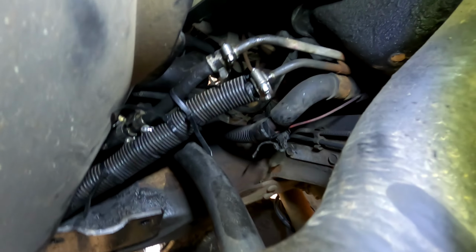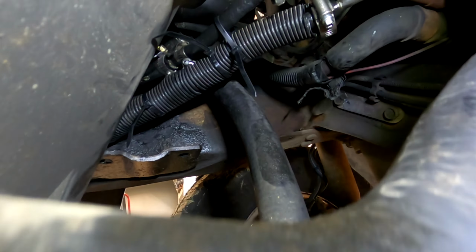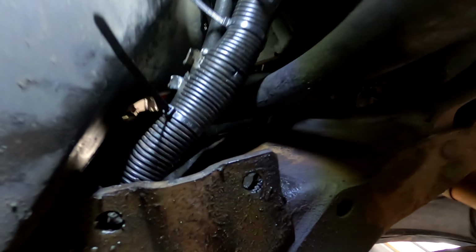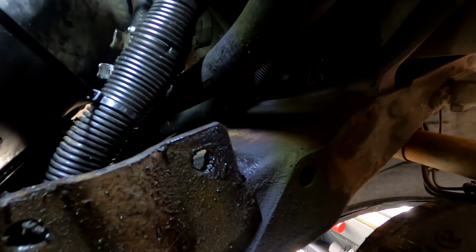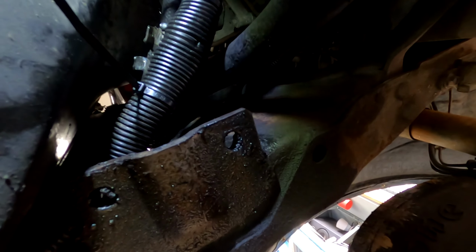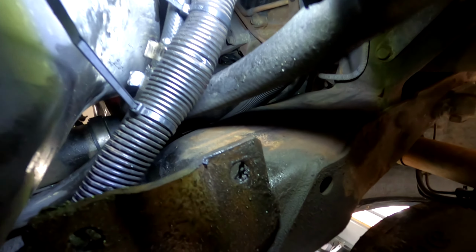And then let's look on the underside. So there's the underside. I put some wire loom on the one piece because it was rubbing against that heater hose. Everything's tightened up on there. You can see I zip tied the wire loom on that side, just so it didn't rub on that heater hose. I was able to pull it through, so it's kind of far away from the heater hose. But I'm afraid if we're driving, it could vibrate its way over and rub against it.